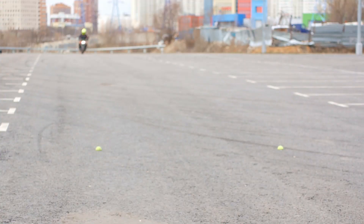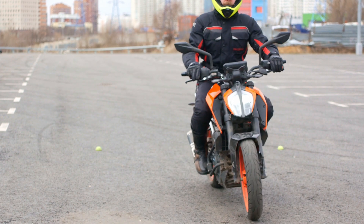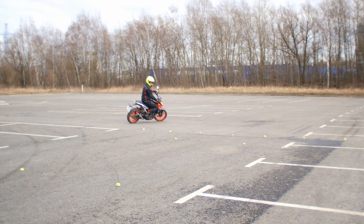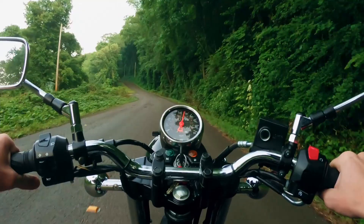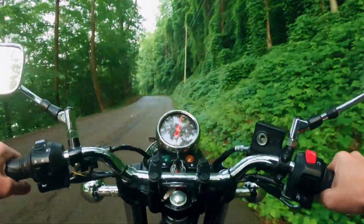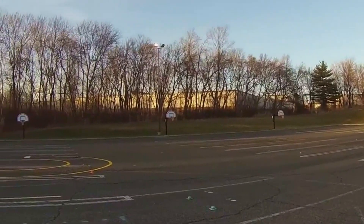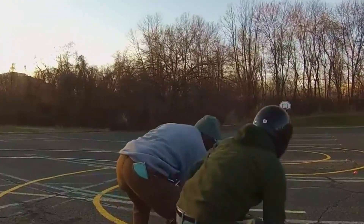So even if you're an experienced rider who knows what you're doing, it's still good practice to have ABS as a safety feature, just in case you overbrake. As I already mentioned, it also makes you a bit more confident, and you can spend more attention on other things than braking. The second popular myth is that you don't need ABS on slower bikes — like, this bike's top speed is only 80 miles per hour, why would you need ABS? In reality, you can lock up a tire even at pretty low speeds, as you can see here. Yes, it's better to drop the bike at that speed than at 100 mph, but it's really not a pleasant experience, and ABS would be pretty useful in those situations.